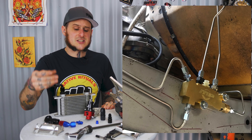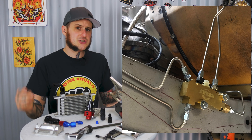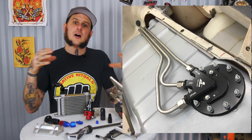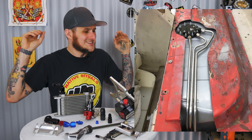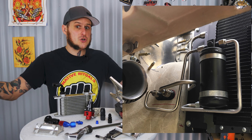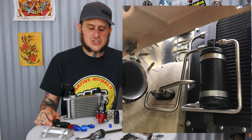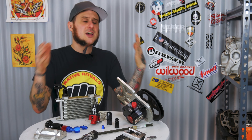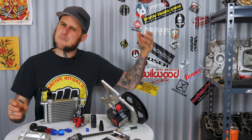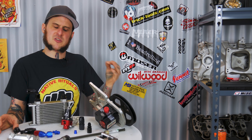When you're doing a brake system, you need to run hard line tubing. Even properly pressure-rated teflon-lined soft tubing will expand a little bit under pressure. If you ran soft tubing for your entire brake system, you'd have a very spongy brake pedal because so much tube would expand and take up the pressure you're applying at the master cylinder. In brake applications you want steel or stainless steel line so it can't expand under pressure, only using soft tubing where absolutely necessary at the wheels or from the master cylinder down to the frame rail.